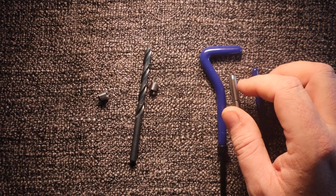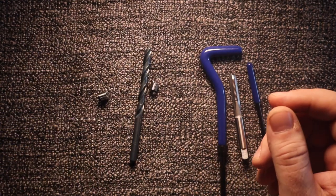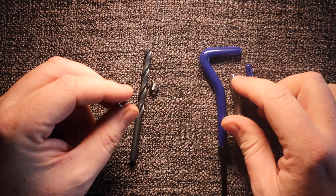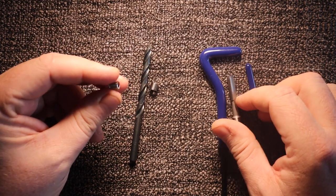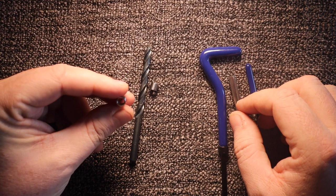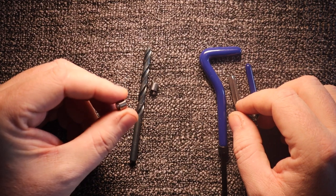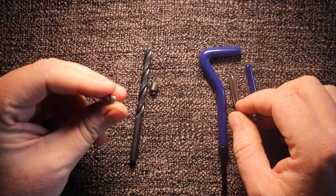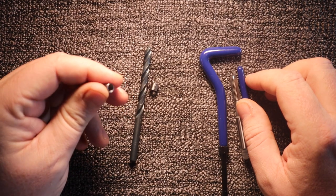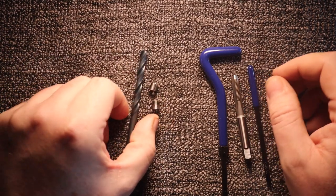Welcome back. Today just a quick video about helicoils. I need one because a couple of weeks ago me and John fitted some heated grips to my bike, and while I was trying to put the seat back on I stripped the threads that hold my seat down. It bolts directly into the rear subframe, and it was either 500 pounds on a new subframe — which isn't an option — or repair the threads that I've damaged.